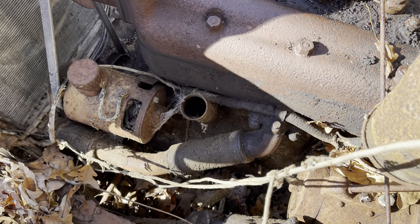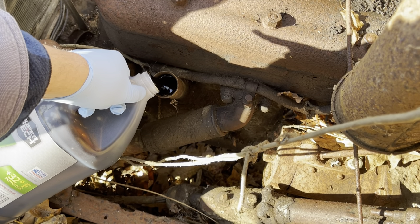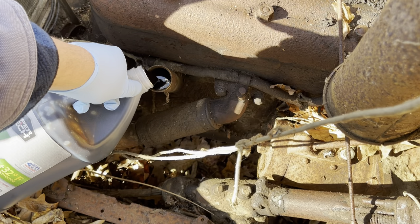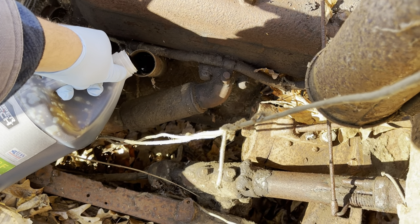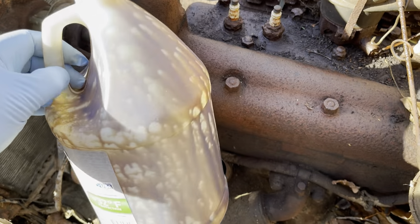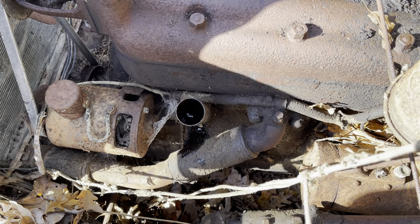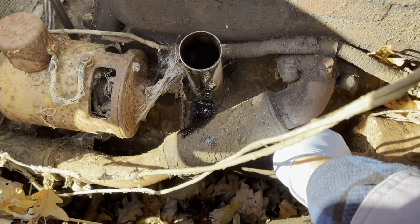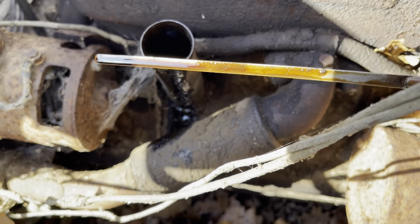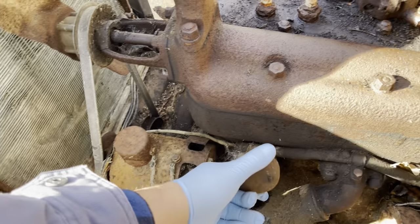Remove the cap and add some fluids down here. The main thing is just to get some oil down in that crankcase and start trying to lubricate things to the point where it's acting as a penetrant and hopefully free up anything that's stuck down there. I just finished putting a gallon of oil down in there — I know some of you will be cringing, but this is a low-budget 'can we get it freed up' situation. Checked the dipstick: it's plenty high, and there's no bubbling to indicate any water, so at least that's good.